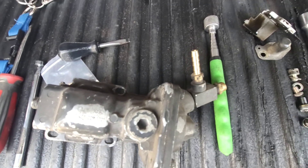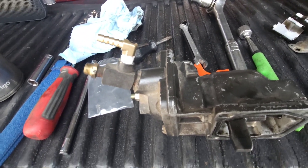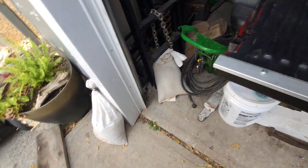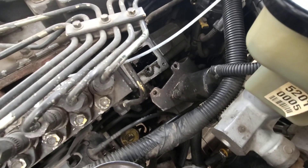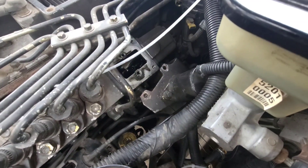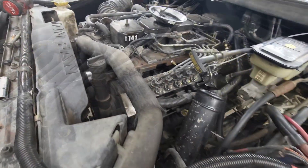Got her on — put some thread tape on there so it seals up, and then you basically just install it back on. The process is pretty much the reverse of taking it off. There's your hose that you hook it up to. Clean the oil off, push the AFC forward back to where it was, put the screws back in, and start her up to see what it's like.